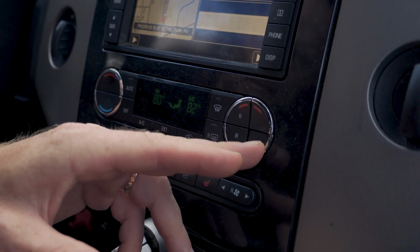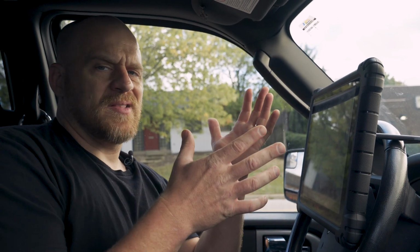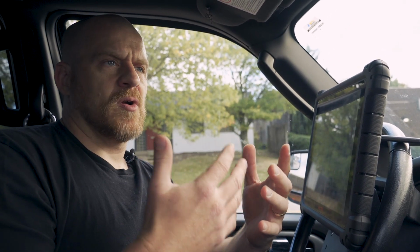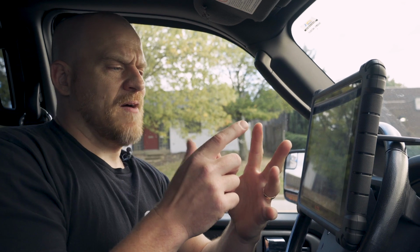So for you guys following me right now that maybe you don't have a high-end scan tool where you can view data parameters, don't worry about the scan tool right now. This initial test is one that anyone can do. You're just using your ears and understanding that a temperature blend door is simply a motor, a reverse DC electric motor with a position sensor on it. And it's probably 5 wires, I haven't looked, but typically they are, where you'd have 2 of the wires be in motor control.